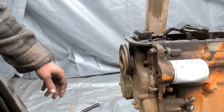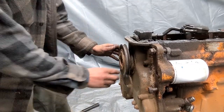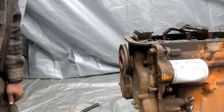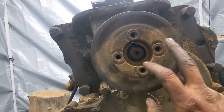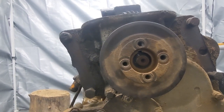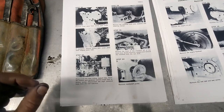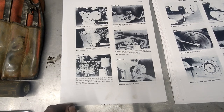Sweet! I put a two-by-four in there to lock it just so it wouldn't turn - probably didn't matter with the impact driver. That's keyed in place. I think I'm going to need a puller to pull this pulley off. Let me try tapping on it with a hammer, but I don't know if we're going to get this off tonight. I don't want to tear that up, so I need to go get a puller. Everything's closed right now, so we're going to move forward and get some more stuff apart tonight.